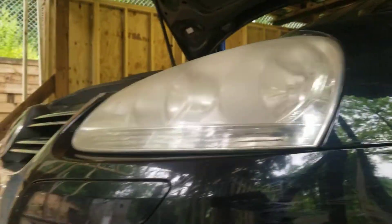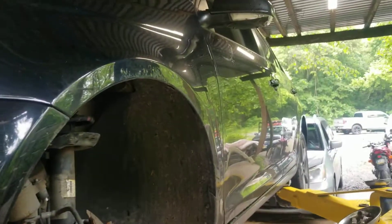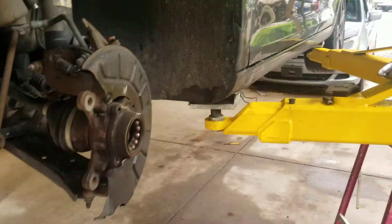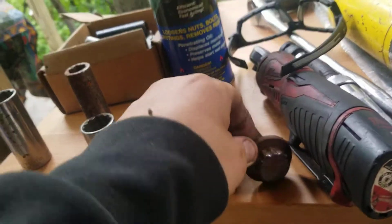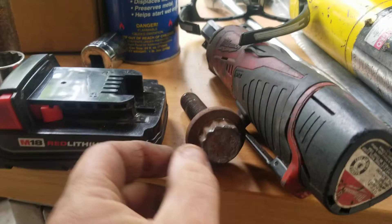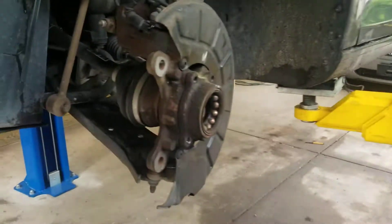On today's episode: a 2009 Volkswagen Jetta 2.5 liter, left front wheel bearing. First of all, there's a big bolt here — a 12-point. I'm sure that's some special tool from Volkswagen, but I'll use a 15/16 12-point on it.